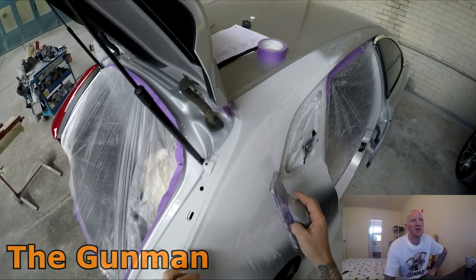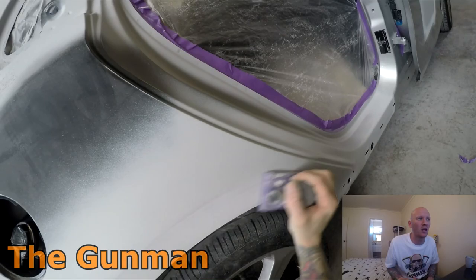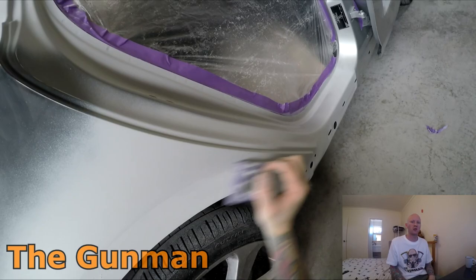Look, sometimes if I've done the repair and I know that it's done really well, or even if the panel beater has done it and I know that it's just a small repair, sure, put 3 coats on it. Block it with 320 even sometimes. But on your average jobs that have got big filler repairs on it, whack 4 coats on it, please, Moses. And I like to give it a good block down.